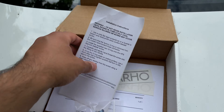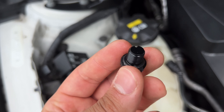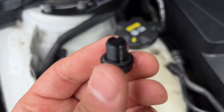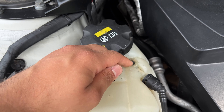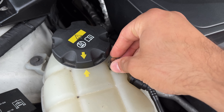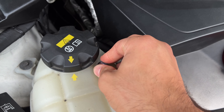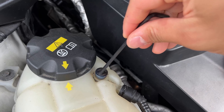To install this, take a large flathead screwdriver — you can even use a Phillips head or a quarter — and just unscrew the original bleeder screw. If yours already broke and you're missing the top piece, try drilling it out, but try not to get anything to fall inside the expansion tank. If you're doing this ahead of time and still have your original bleeder screw intact, this is going to be much easier. I got the widest flathead I possibly could.